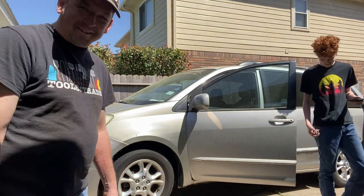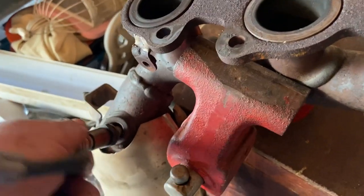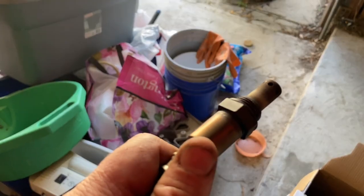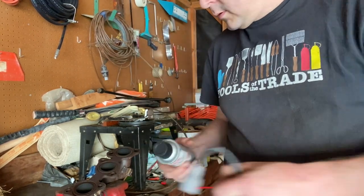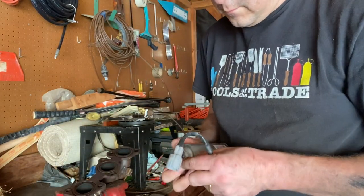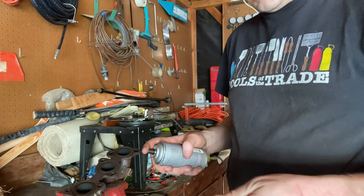With your original cat in the vise, go ahead and break loose your O2 sensor. I'm going to clean it — this is the front one; I'll pull the back one off and clean it too. I'll use some mass airflow sensor cleaner, which is basically electrical contact cleaner, and just let it dry out really well.